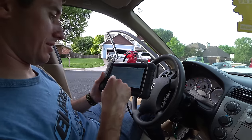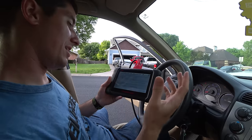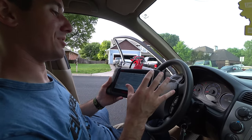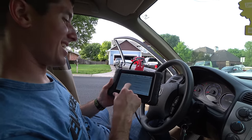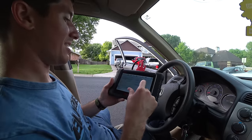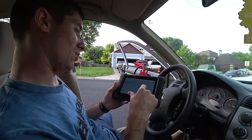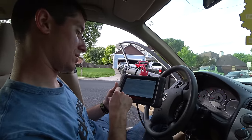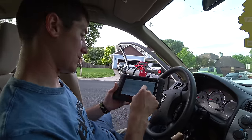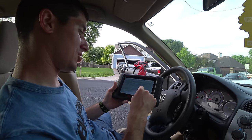Okay, we've got our codes here. The first one, P1035, which is heater for an O2 sensor, heater malfunction. All right, good, good. Most of these are IMA system malfunctions. O2 sensor heater, O2 sensor performance, O2 sensor heater. Makes sense if there's no battery power, maybe that'll fix itself. One ABS code, which is battery voltage failure, that checks out too. All this SRS stuff, probably battery voltage, we'll find out.